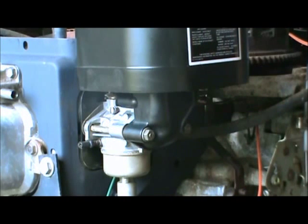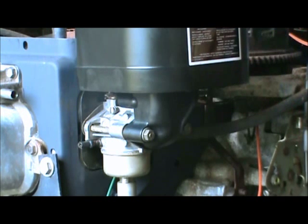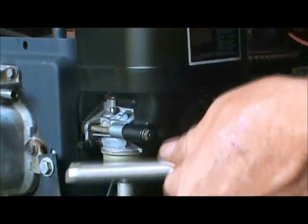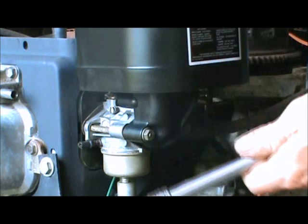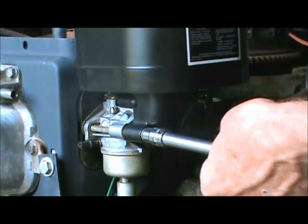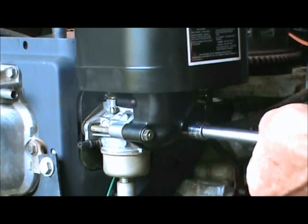Then you grab your wrench, your ratchet, and in this case, an 8mm. I got a smaller one there. I need the right one. So we're going to 10mm. Put that together like that. And we're going to snug these down. Now, I mean snug. I'm not talking about tighten, just snug. Okay? It's kind of like the wrench, turn it, and when it feels a little tight, you know you got it. Okay? That way you know.